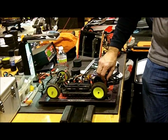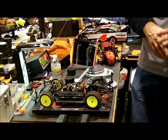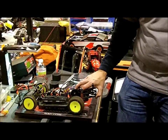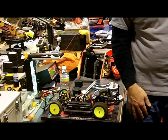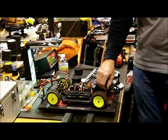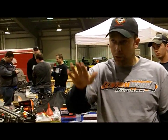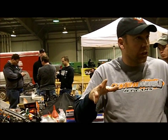When you come back here, well, I'm jacking weight and I'm jacking the collar down. I'm putting left rear into it, so I put a chip in that bucket. But I'm also raising the rear ride height and leaning it towards the right front, so it's going this way. So that's another chip in that bucket. So you just did a little bit of one and a little bit of the other. Why would you turn that? He wanted to get into the corner a little bit better. He didn't feel like it was cutting in as quick, but he needed more to get off. So by giving him a little bit of left rear, it also put wedge in the car, helped it off, but it also pitched the car, so it already wanted to get in the corner a little bit.